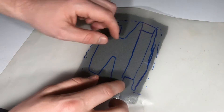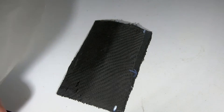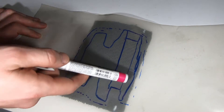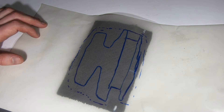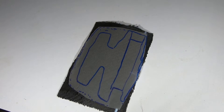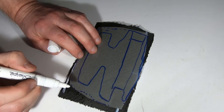So I've marked out my template. As I said, we're ignoring this area at the front here and just looking at the area around the back. I just realised I needed some alignment marks for how far forward and how far back it needs to go. Those two alignment marks line up with where the forward edge of that rib sits, which means the doubler sits on about there. What would have been even better planning would have been cutting this to size in the first place, but it's done now. So I'm just going to mark out the back edge here — that's pretty much where the other rib sits — so we'll get rid of a couple of millimetres at the back.